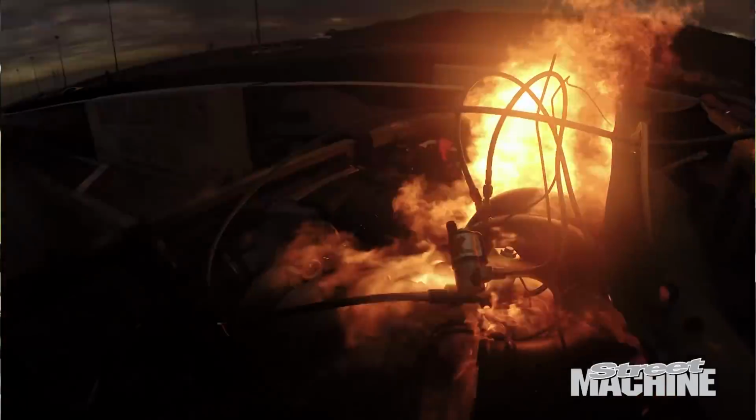The reason it caught fire is because the nitrous leaned out and backfired and sprayed fuel all over the engine bay. Now, we decided to put a fuel pump in it, so we took it to Max Performance because it's a fairly big job. Took it to those boys to put a fuel pump in it, and then it snowballed from there.